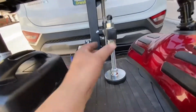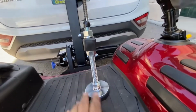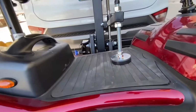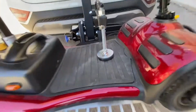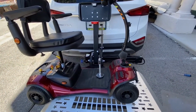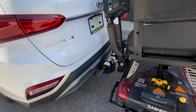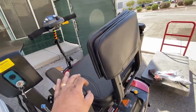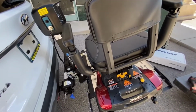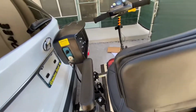And like I said, you just need to adjust the height of this and tighten it down enough that it holds the scooter in place but doesn't crack the bottom shroud. The last thing you need is to be replacing the shroud. But that's that done. All I've got to do is put the license plate on and then call the customer to tell them it's done. But like I said, don't ever swing it away with the scooter on the platform. Always swing it away with it off the platform, otherwise you'll sprain your swing away. It's too expensive to replace.